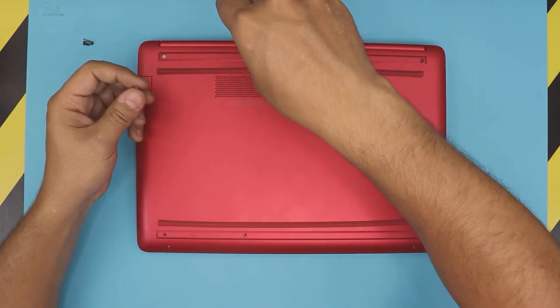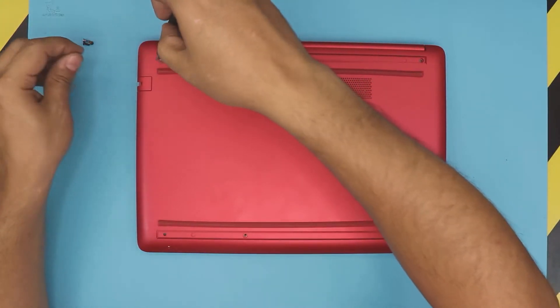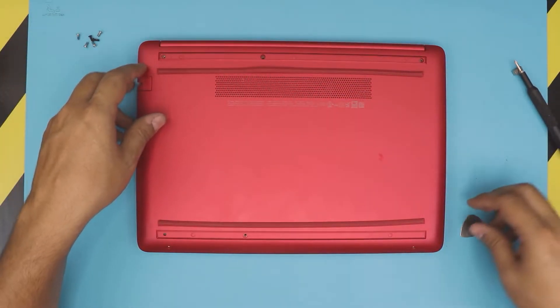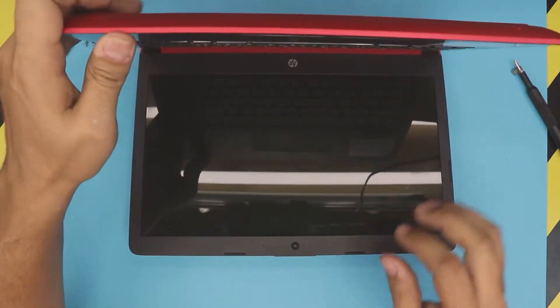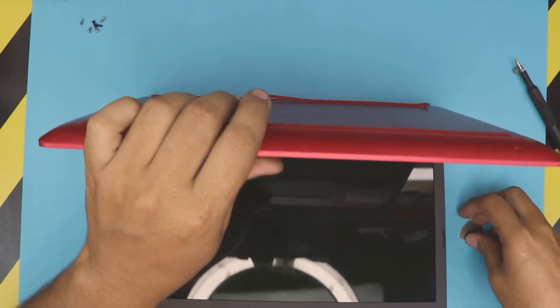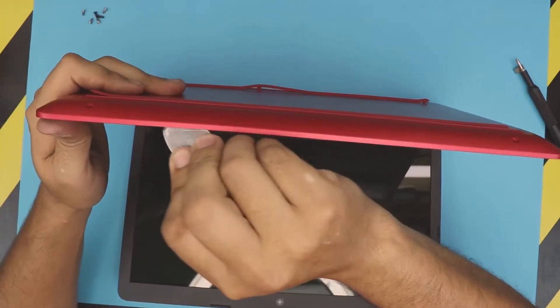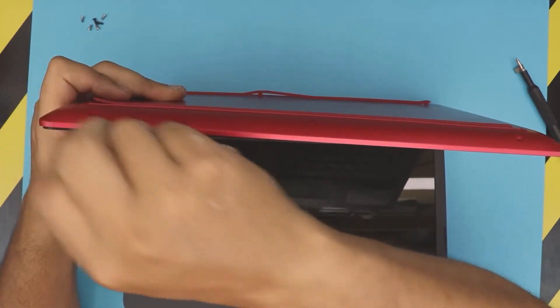The rest are colored in a silver color. Once you've removed all the screws, what you want to do is open the laptop to a 45-degree angle and then stick the guitar pick between the top and the bottom cover, and wiggle it around — twist it, but not too much.